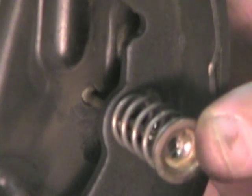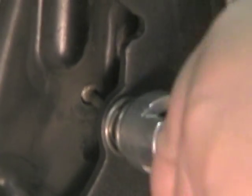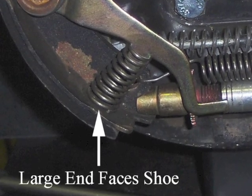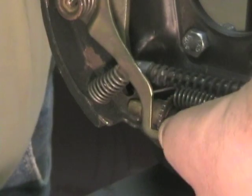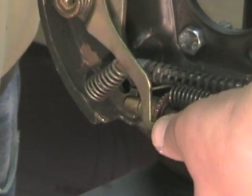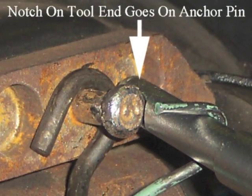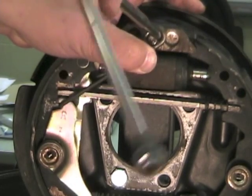Position the front brake shoe on the backing plate, then install the hold down pin through the shoe and install the hold down springs. Lift up the actuator lever and install the lever return spring under the lever with the large end of the spring sitting against the rear brake shoe. Hook the actuator link in the notch on the actuator lever, then use the drum brake spring tool to install the spring. The tool has a cutaway on the end that is rested against the anchor pin so the spring can be slid into position.